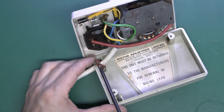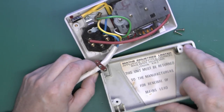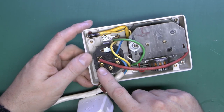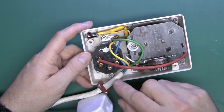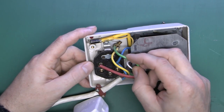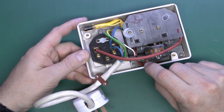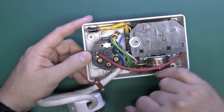So what we'll do is remove these screws — actually it just pulls out, so I don't have to unscrew it after all. We can just remove the back as a complete item. Inside we've got the outlet socket, which connects via the switched line going over to the timer. The neutral goes straight in and obviously links into the motor as well. There's a green earth wire which goes over to the earth terminal, and that's also connected to the incoming earth line, going down to a tab at the bottom.